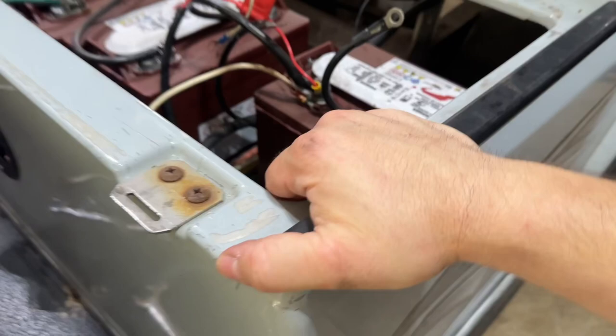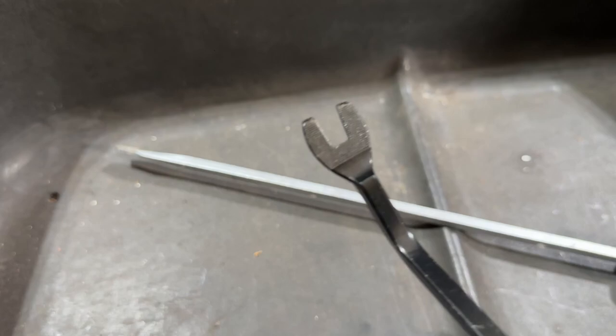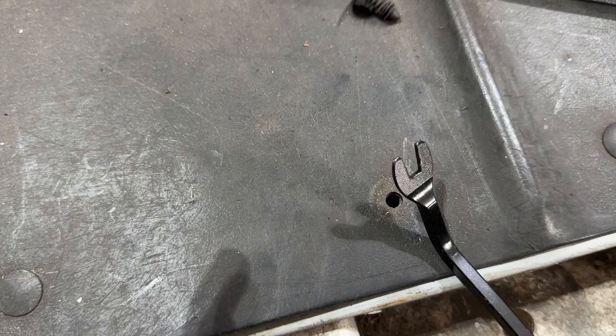I had to take out the battery, by the way. Once you get these two screws out, it starts to become movable. Go around to the back — you've got these little plastic clips. I see a lot of guys coming in here with a screwdriver and really prying at these things, and the problem is you mar up all the plastic. Go to my link down below, pick up one of these little kits on Amazon — the clips and a little puller for about 10 bucks — and just get under here and pop them out. It makes the work a lot easier and you're not going to mess up all the plastic.